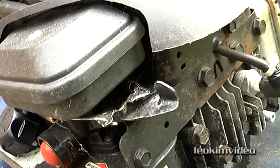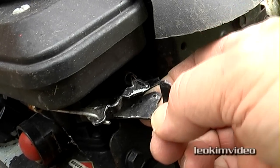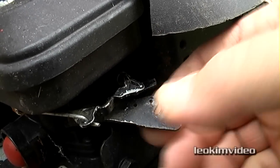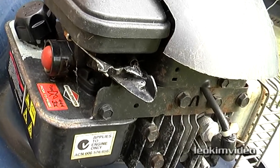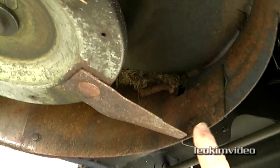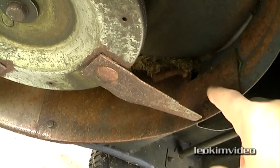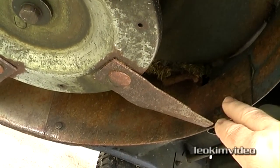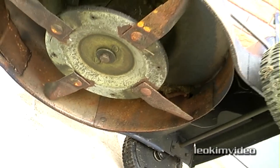The other peculiar thing happening with this lawnmower was it kept losing its ability to have choke, and the throttle was weird. These parts belonging to the throttle control were very easily damaged when running under trees — so in a sense that is a design flaw, considering it's a mower. Looking underneath that mower, I'll show you the modification I did to turn it into a mulching mower. I added this piece of steel into the base plate area, so normally the grass would have been thrown up into the catcher. I don't like catchers, and the catcher that came with this was useless — so this piece of steel turns this lawnmower into a mulcher.